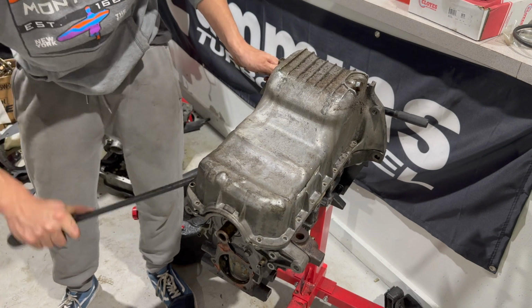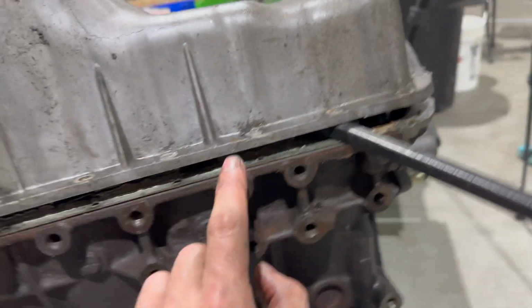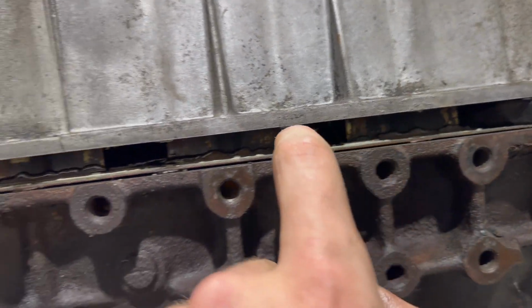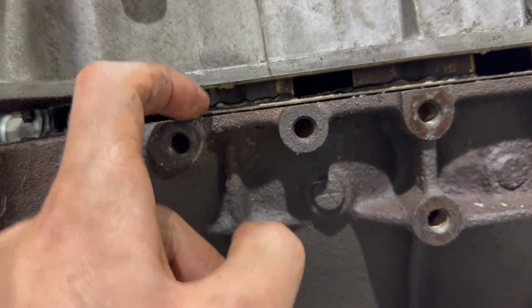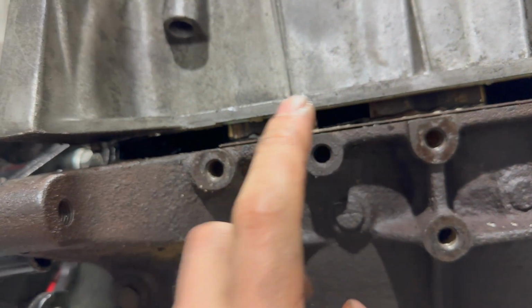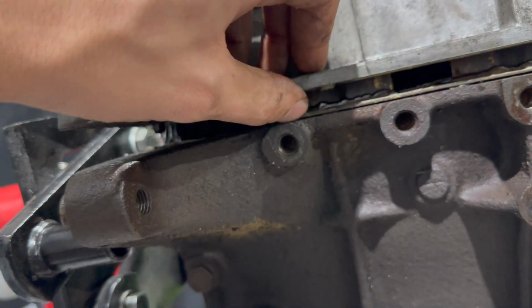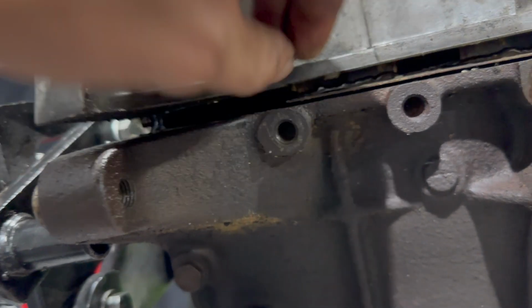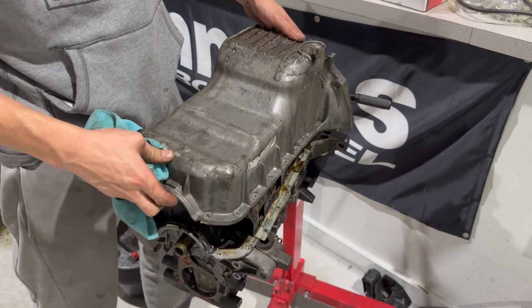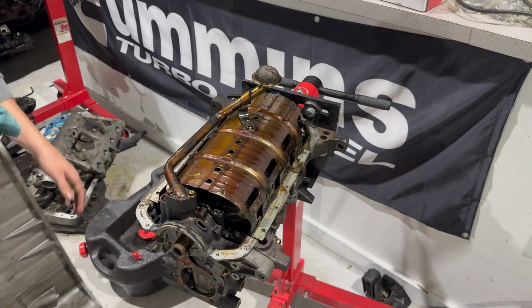So you have to separate the baffle. That's the part that's really hard actually. You have to separate the actual oil pan baffling. So there's this big plate right here. So you have to separate this edge from that. This is what the oil pump tube is connected to. You'll see when I get it off. So first pry the corner up, then make sure this will be pulling up with it, and you gotta rip it apart. So it's just silicone, so you're not gonna break anything. Open back, turn it around, and boom.